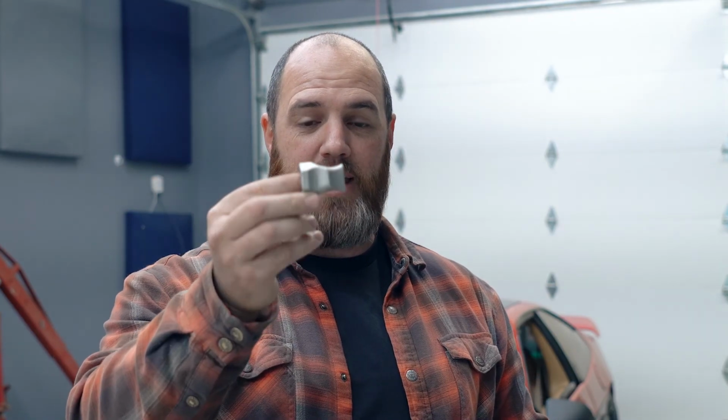So what I'm eventually gonna do this winter, I'm gonna take apart the entire front suspension, refresh it. However, for the time being, I'm gonna put these bad boys on. Basically, these are spring spacers, or these are called spring boosters. They're super simple. You just stick them into the spring, you give them a twist, and they lock in. It says up to 1 inch of lift, which I think is gonna be perfect. That's gonna make the car pretty level.